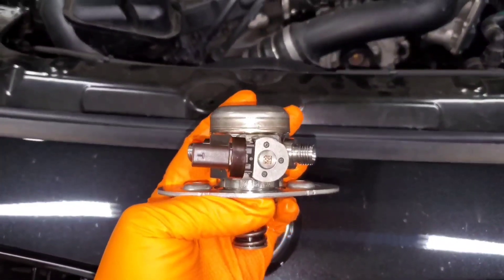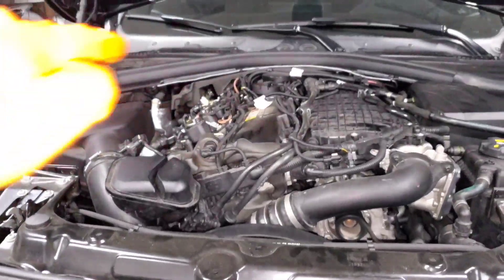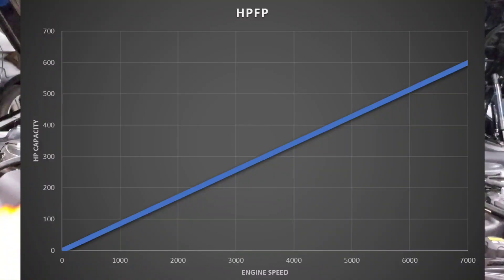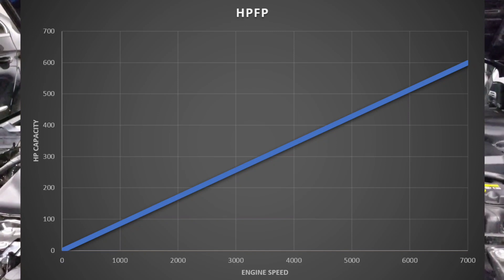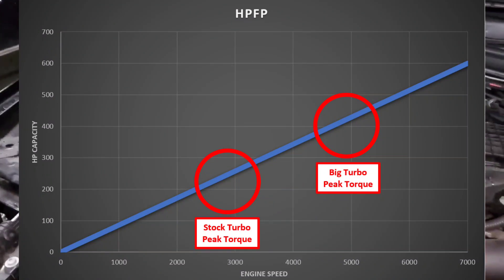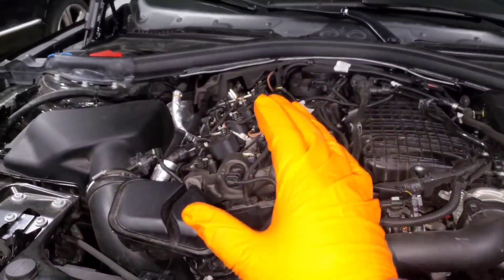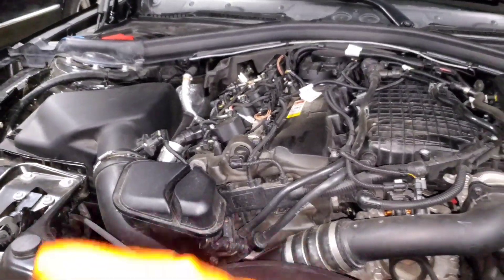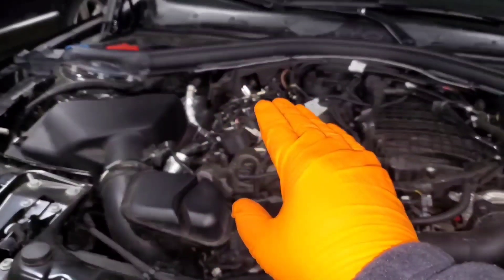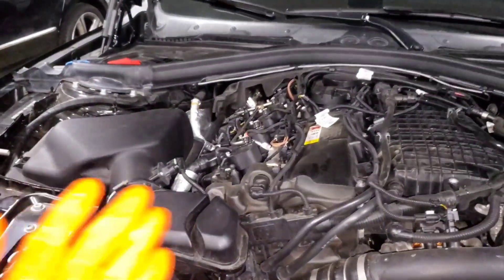All of your fuel flow and power capacity is up at redline. If you're making a decent mix, you'll have a flat torque curve all the way to redline because for every engine revolution as you increase RPM, it's flowing more fuel to match exactly. That means power capacity goes up all the way to redline, just like an NA engine. So if you're trying to max out the stock turbo and run full E85 to see how much power you make, you're making all of your torque down low — but all power capacity is up top. That's why buying a bigger high pressure pump just to run more fuel on the stock turbo is a completely inefficient way to use your high pressure fuel system. You could make more power with a bigger turbo and the TU pump versus a big high pressure pump and the stock turbo with an ethanol mix.